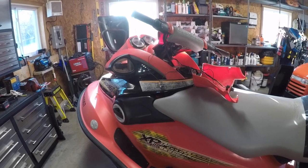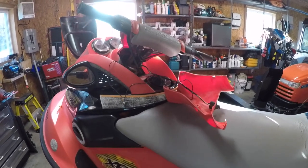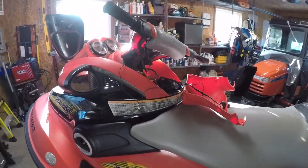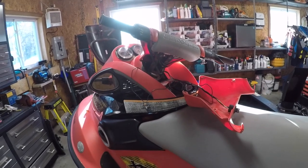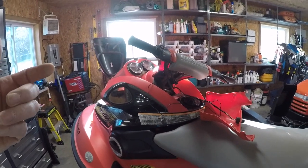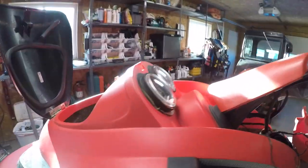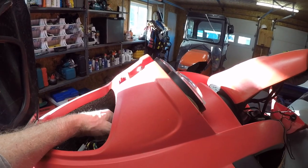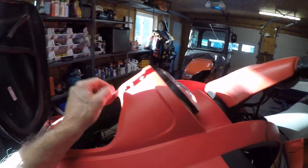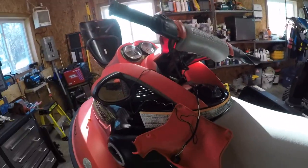We'll cut and just twist the wires on as a temporary test to see if that's what the issue is. I mean, worst case, I put this one back on and reheat shrink it, it's no big deal, but at least that'll let me know what's going on. It's kind of hard to figure out what somebody else has done, but I am suspicious of this tether, because when I unplug it, the beeping stops, so there's something strange going on here. So I'm gonna just clip the wires. Should probably clip them down here, and that way if there's a bad connection in the wire, no, I'll clip them up here and then we'll check the connection on the wires just to make sure that there is continuity there, and go from there.